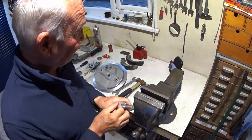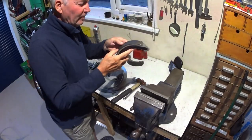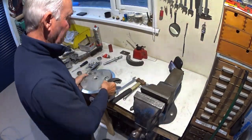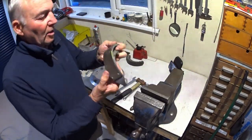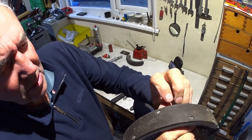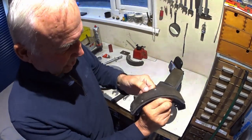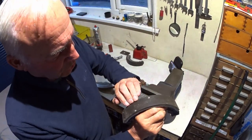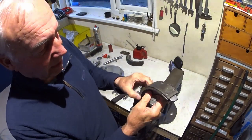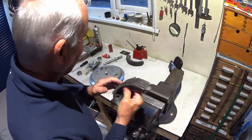And that had hooked up on the back of that first diameter — that's why it was further forward in the hub. But the problem it's caused is: because this was never allowed to go all the way into the drum, you've got like a two-millimetre ridge where the shoes have never actually been in the drum. So I'm just going to try to linish that edge, because the shoes have come good — I've managed to get the grease out of them with some brake cleaner where the shafts had been over-greased. So they're lovely and dry, as they should be.